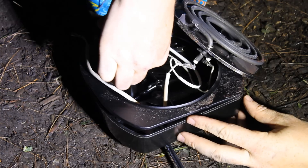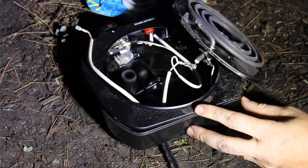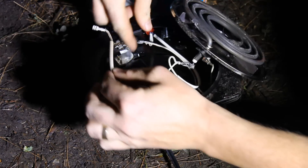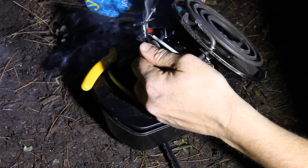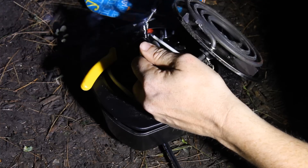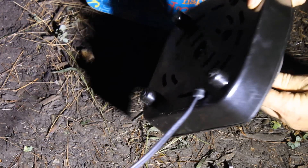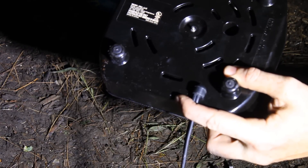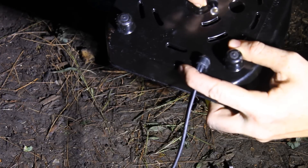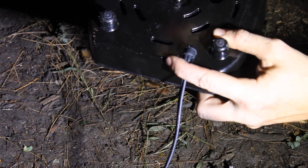To hot-wire the stove, open it up — there's a wire going into the knob section and a wire coming out. Just disconnect those and fuse them together. You want to do that mechanically by stripping and twisting them together. I soldered mine, but that wasn't the greatest idea because the heat can melt the solder and it can come apart. It's really simple — takes about five minutes and one screw to put it back together — and then it'll just stay on all the time instead of cycling off at a set temperature. You can then regulate temperature by simply opening or shutting the bottom drawer a certain amount.